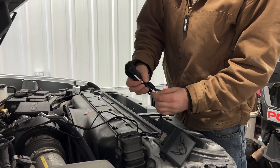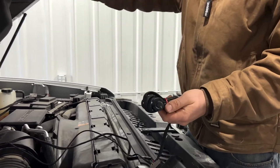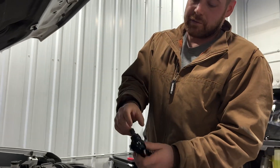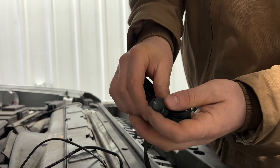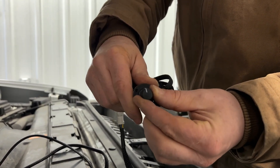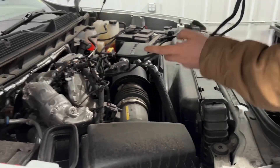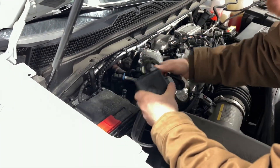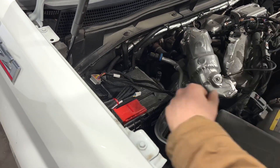Our harness comes bundled up, and it comes with a wire long enough to run through the firewall if you wanted to, but I wouldn't bother — the majority of customers just leave it under the hood next to the module. All the way to the left is stock or counterclockwise, and as you turn it right or clockwise, it goes low, medium, high. Medium is a good all-around setting. Tuck the wires away neatly and mount it somewhere — right next to the battery is usually good to go.